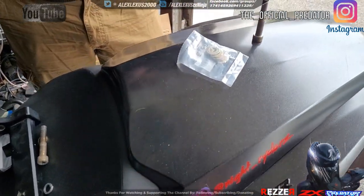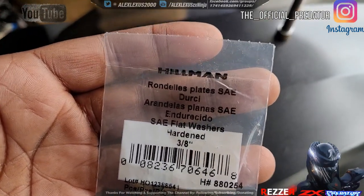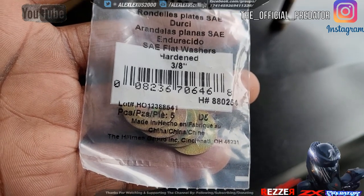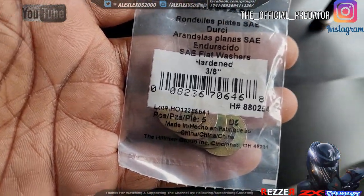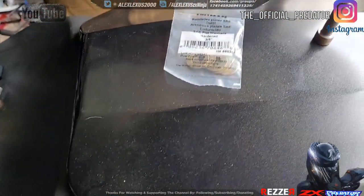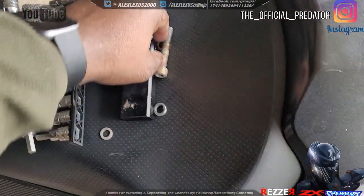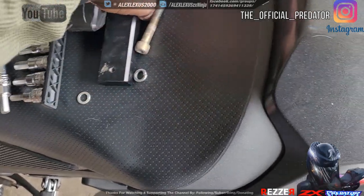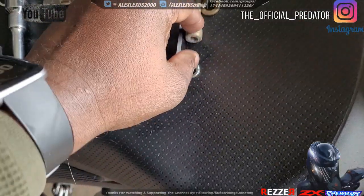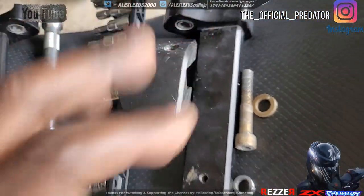All right, folks, we are back. We had to go get the washers. The size was M10, 1.25 metric. If I don't forget, I'll put it in the description. But what you gotta get is the spacers to put in the bolt here, and then the washer on the inside so that they'll have that nice tug.